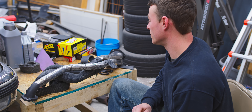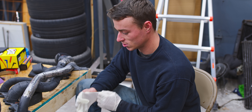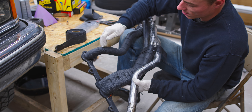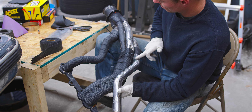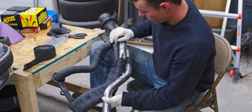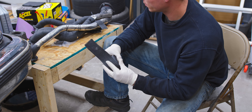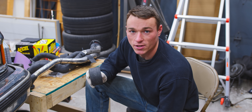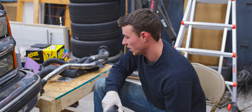First thing — you definitely want to wear gloves for this. This is a fiberglass exhaust wrap and it'll definitely make you itch. What I've done so far is just wrapped these two. I'll show you how I did these and then we'll continue the rest of this tube, probably wrap to about here, wrap all three of these and then connect them all and do the rest of the collector. These are just temporary zip ties to hold everything tight for now. This is our exhaust wrap and out of the box it's really stiff, not very easy to work with. What we're going to do is run this under the hose — that's going to soften it up and make it a lot easier to work with so we can pull it super tight and get some nice wraps.